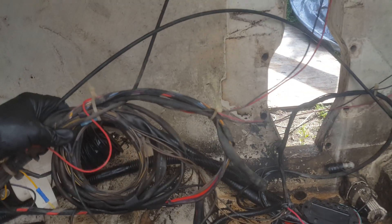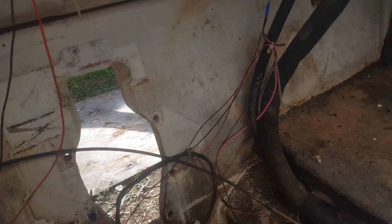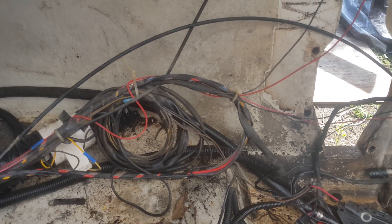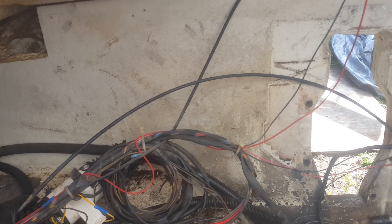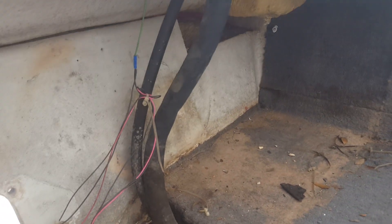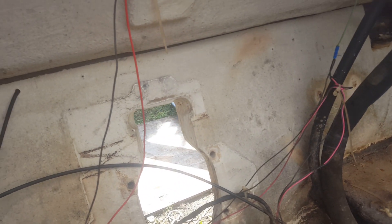This concludes part 10 of the series — a little bit shorter than you're used to. We're going to start preparing and moving all these wires out of the way. Do the same thing on your boat: shift cables, fuel lines — you can leave those but it's going to be a pain, so go ahead and remove those. Get a good view of the transom with no electrical components. Also, anything in this general vicinity is going to get coated in fiberglass, so take precaution with your carpet — you'll need to start removing that as well.